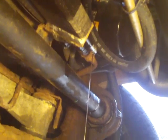Pop that first hose off. It's right there. Let it drain into a bucket, and then the cooler's draining on this rag. My jack's in the way, so I can't get a bucket underneath it. No biggie. We'll wait for that to finish draining, and then I'm going to pop off the other hose and try to get those bolts out. I'm going to go ahead and soak those bolts now with PB Blaster, just so that if they are a pain, then I can get them out easier.